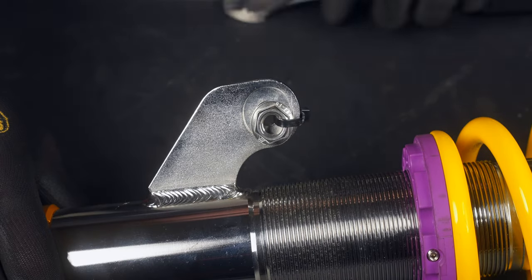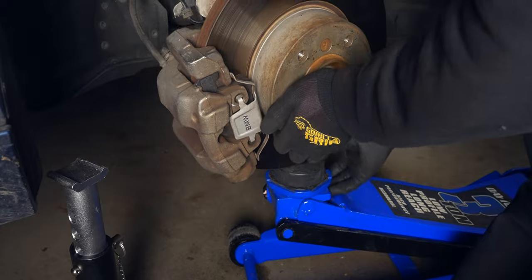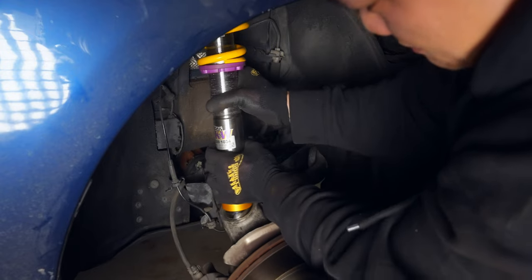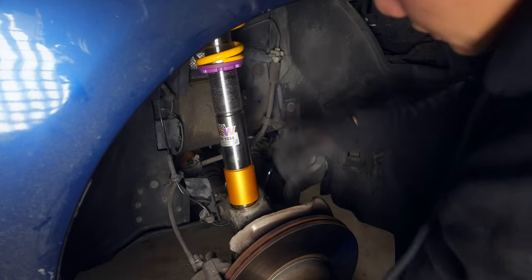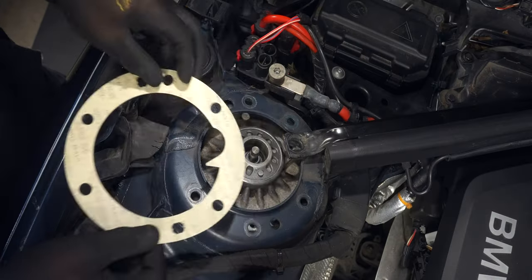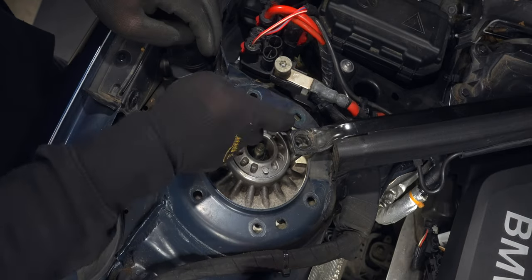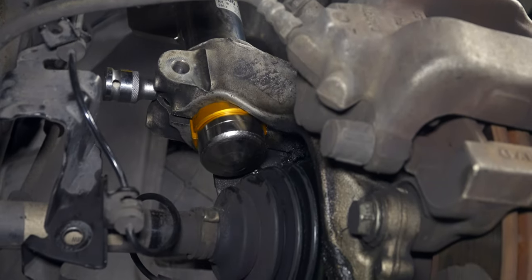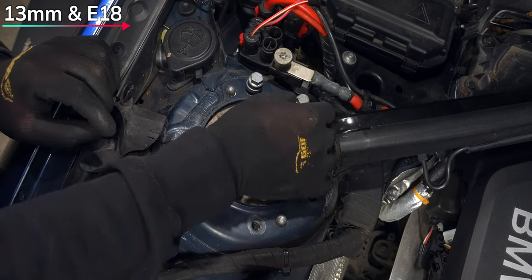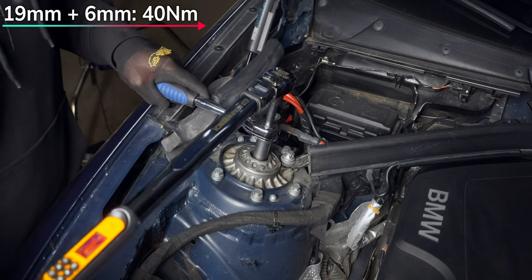Since SPL end links come with nylon nuts, the ones supplied by KW won't be used. At this point, we're ready to bring in the strut and allow the assembly to rest on your jack at near full droop. This will allow you to bring in and align the strut to the knuckle before sliding it in and make sure it bottoms out on the bottom lip. Now there's no risk of damaging the paper gasket that will go on the top hat. Simply align the rough cutouts to the nubs on the top hat and the other remaining holes should line up to your bolt holes. With that in, jack it up and place in the 13mm bolts and E18. The 13mm get torqued in the star pattern to 28 Nm while the E18 gets double that at 56 Nm. If you also want to re-torque the top nut while it's under load, you can do that here as well.